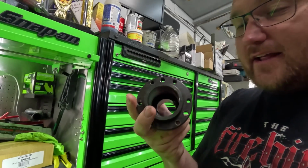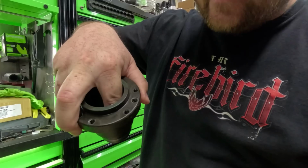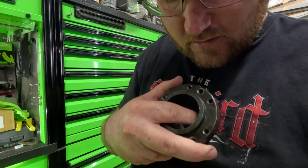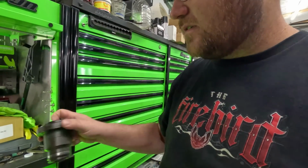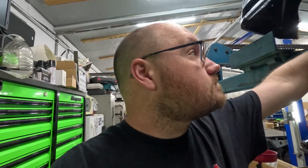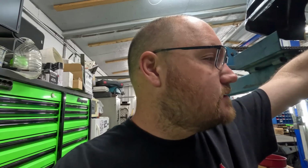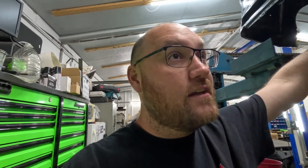Because of that pulley they add in there, the face of the dampener, like my finger is way down in here right now, they moved it up about 1.5 inches, 1.25 inches. And that ends up requiring a much longer crank bolt if you want any threads. So I bought an LS7 ARP bolt because it's the longest bolt you can buy, and it only had 2.5 threads of engagement in the crankshaft snout. So that wasn't going to work. So I got a couple of 10.9, 6-inch long, I think 160 millimeter, bolts from Fastenal, and they're $7, so that was kind of nice.